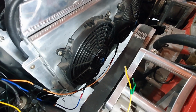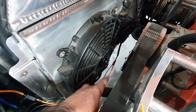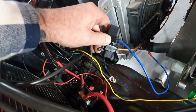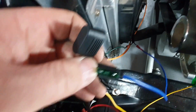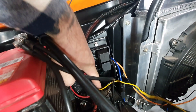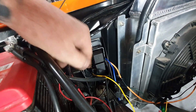Look down the bottom here, you can see the two thermo fans - they're about 12-inch fans. I've temporarily connected up fan one on the right and two on the left with fairly heavy gauge wire. These go through individual fuses - you can see underneath these fuse covers here - each one of these fuses is 30 amp. They're connected up to this Davies Craig thermo fan switch here, mounted down here with a little LED display.